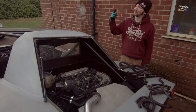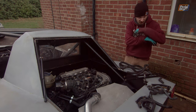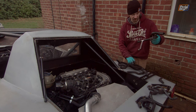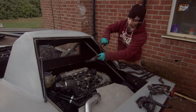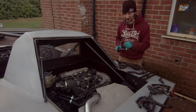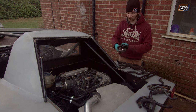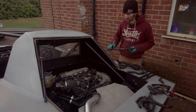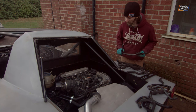That took quite a lot longer than I expected — we're losing a bit of light now. We've been through our big box of water hoses and coolant lines, filtered through it to find all the bits we needed. We've made this one here, which comes down off the expansion tank, sneaks in underneath our intake pipe, and then clamps on with a little bolt onto the framework. This is a little piece of what was left of our MGTF coolant lines. We've heated and bent it to change the angle so it fits better. We've also made up a little metal bracket and arm that fits over the frame. Now we just need to do the elbow around the end onto the second piece of pipe where it joins the engine, which is hopefully the easy part.